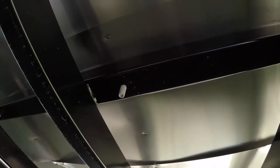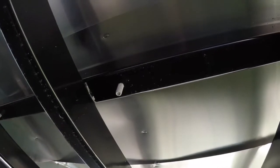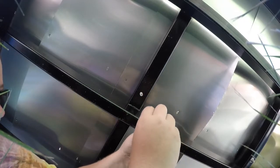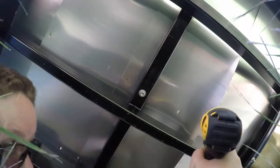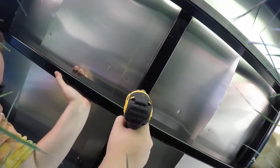Now we're underneath the trailer. You can see those bolts coming through that I just drilled, and I have to finish attaching them. You can see on this side I've already attached those bolts, and I have to do the same with these. There's the first one — washer, lock washer, regular nut — and then take an impact driver and secure it on. Now that's not going anywhere.